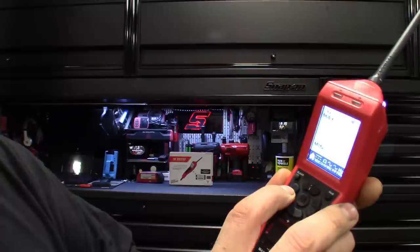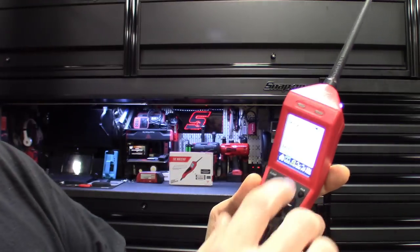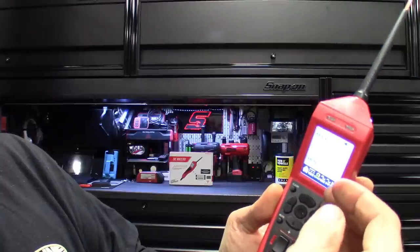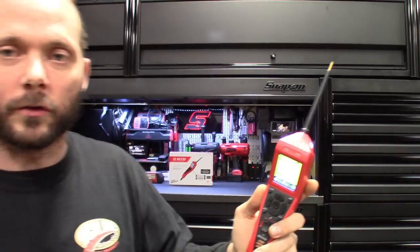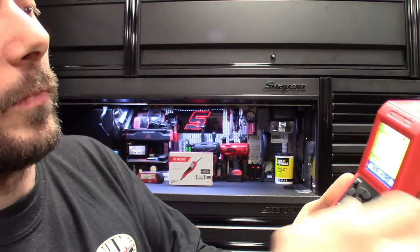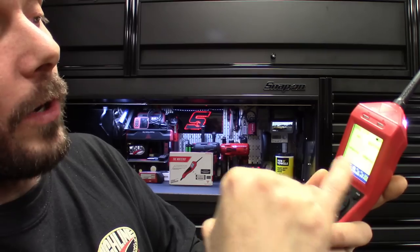You could also test your speakers — the hertz on speakers. What I also like about it is everything's pretty much color coded. When you're at voltage, you've got a blue screen; switch over to ohms, it turns into a white screen. So you'll always know the menu at a glance — muscle memory will take over. You'll know what mode you're in right away by the screen color. This is your continuity function and this is your peak-to-peak function. The tool has a speaker button you can turn off, and a clear button so you can retest without disconnecting the tool or flipping out of the menu. The same applies to your hertz and frequency — you can test duty cycle, pulse width in milliseconds, and then clear and retest without backing out.